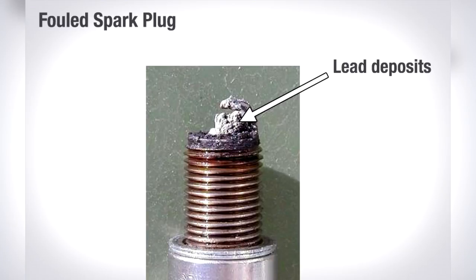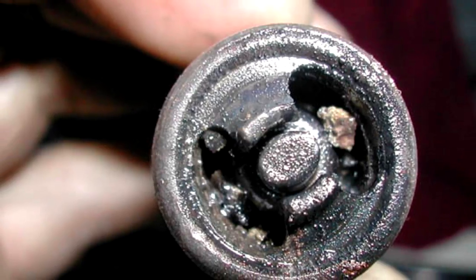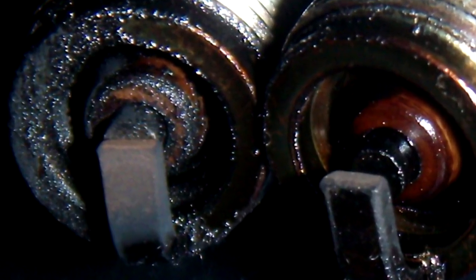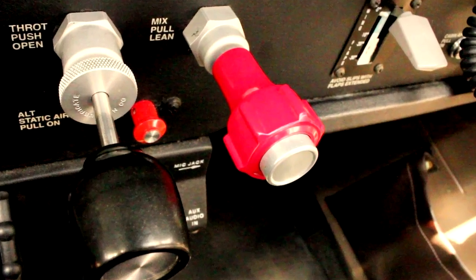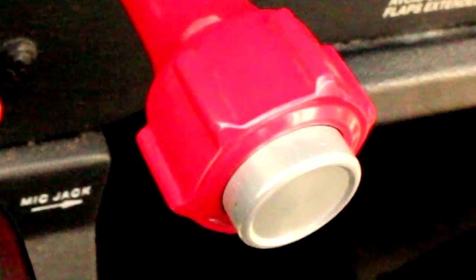This creates a progressively richer mixture that can result in engine roughness and appreciable loss of power. The roughness is normally due to spark plug fouling from excessive carbon build-up on the plugs. Carbon build-up occurs where the mixture is too rich and lowers the temperature inside the cylinder, inhibiting complete combustion of the fuel. This condition may occur during run-up prior to takeoff at high elevation airports and during climbs or cruise flight at high altitudes. To maintain the correct fuel-air mixture, the mixture must be leaned using the mixture control. Leaning the mixture decreases fuel flow, which compensates for the decreased air density at high altitude.